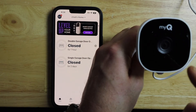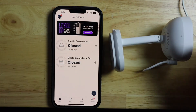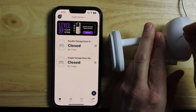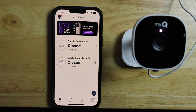Had it not started blinking blue after we deleted the device, you'd flip it on its side. You can see that small little hole — you have to stick a paper clip in it and touch the button. You'd hold the button in for 10 seconds and it'll put it back into pairing mode. You can now either reinstall it or give it to another owner.